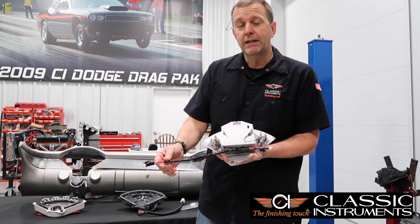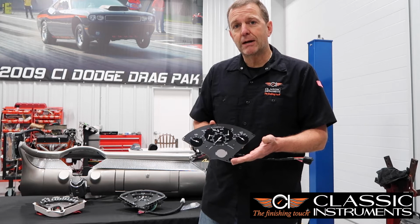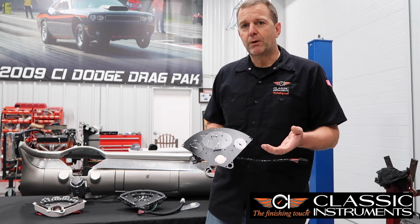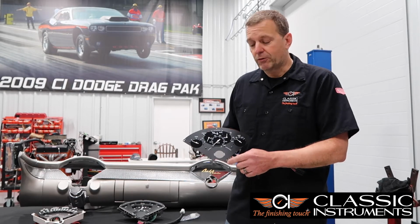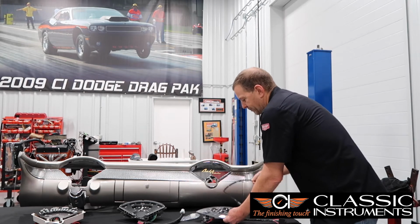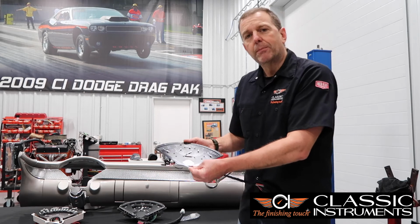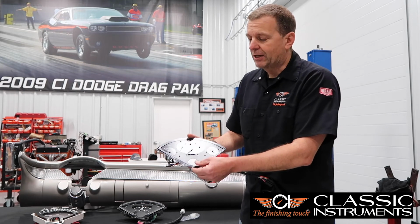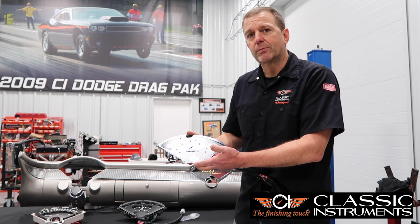They were still a direct plug into any motor or transmission, but it really gave the customer all the features in one piece, mounted into the stock bezel, and went directly back into the dash. So it was a really good piece, but customers wanted more. The one mistake that we made is we thought that the single bulb, which was just like the 55-56, we started with a single bulb, and the lighting just wasn't good enough for our customers. So the team developed an LED board that mounted right back on the face, which added a bunch more light. We made it with a little bit of an amber color to it, so it looked like an incandescent bulb, but you actually got LED lighting, which lit the entire cluster better. Another good job by the development team at Classic Instruments.